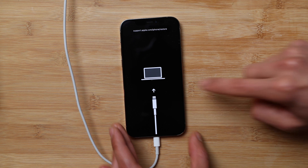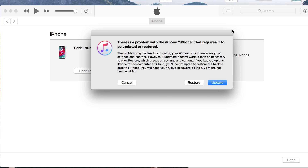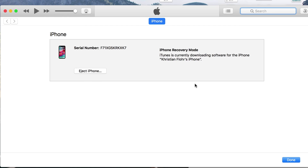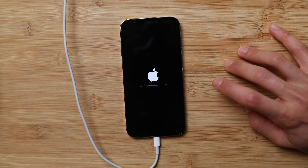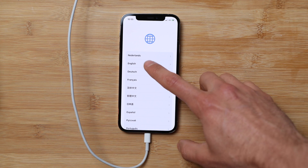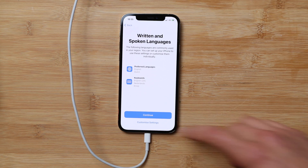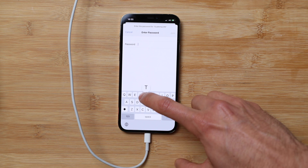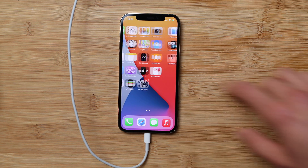The next step takes place on the computer. You need the latest version of iTunes installed — I'll include a download link in the description. iTunes will detect that your iPhone is in recovery mode. Proceed by clicking 'Restore,' and the iPhone will be completely restored and updated to the latest version. It may take a few minutes or even a few hours depending on your internet connection. After restoration, the iPhone will be set up like new — fill in the settings as if it were a brand new phone. If your phone is linked to an iCloud account, enter your email and password; if you don't know them, contact the original owner. The iPhone has now been successfully unlocked and you can access it without any issues.